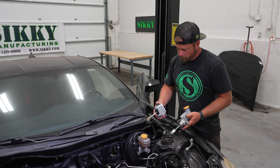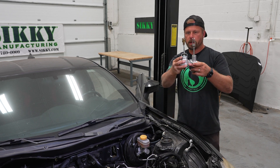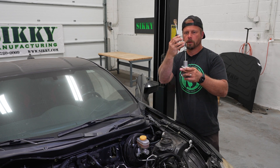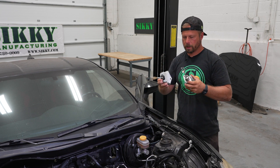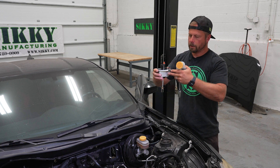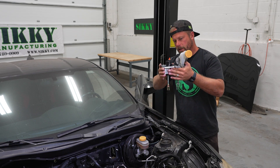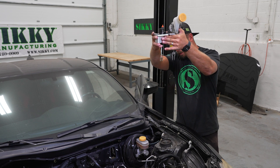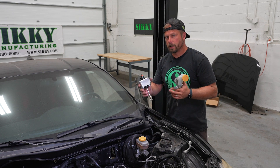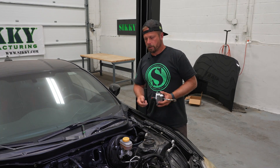All right, so now that we got that all cut out and the fit checked, we need to adjust the clevis location to match. You can see currently it's just right outside, so you want this hole on this clevis to be in the same spot. The easiest thing I found is you can take these both, set them on the edge of a table so they're hanging off — that way it kind of locks them in the same spot. You can take a simple measurement with a tape measure. You're just trying to get it about the same, so we've got a small adjustment to make here. It's pretty close out of the box, but either way we're going to tweak it a little bit. And that adjustment's made to get it in the ballpark — you're still going to want to make your pedal free play adjustment, but we'll touch on that at the end.